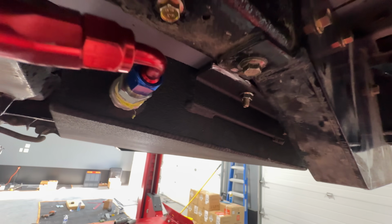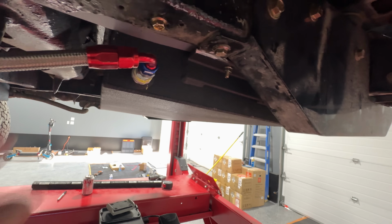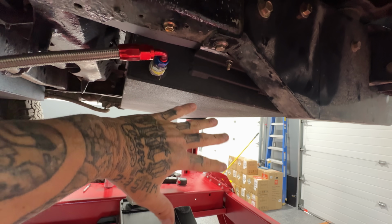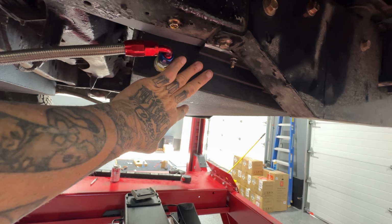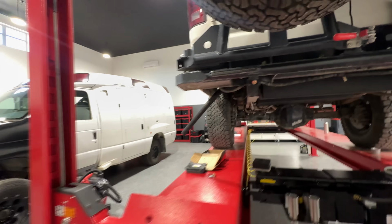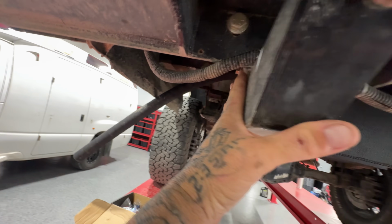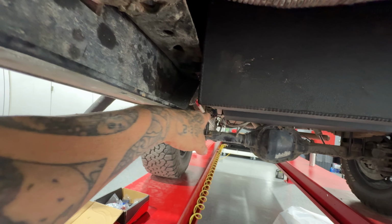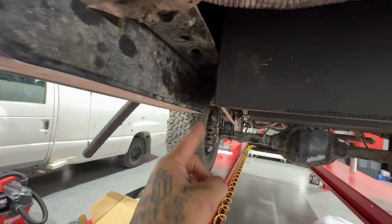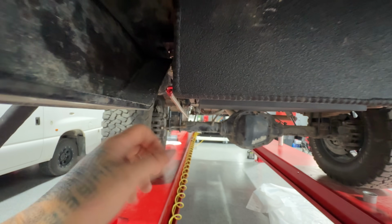And this one here, he just started mounting it up in there. It's bolted in all the way along there with a bracket that goes underneath my frame rail. This thing is solid. We do have a great big piece of sheet metal that we're going to put over this tank just to protect it. This front one's okay, but the back one, this is a really cool feature actually. These supports that J5 Custom Vans built just to support my bumper and everything else come down perfectly below the tank. So if I were to drag anything, this is going to hit. We never planned that. It just worked out. Look at it, it sits about an inch below the bottom of the tank, protecting it.